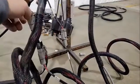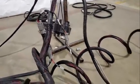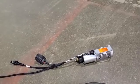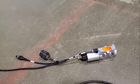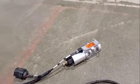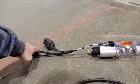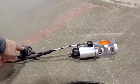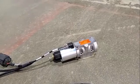That power comes from the auxiliary power plug on that main trunk harness. If we follow the wire that's connected to those two connections, it'll go out and up to the lift-lower solenoid on the main block. The monitor is going to tell whether it wants to be allowed to go one way or the other to control the lift and lower. There's a relay that is triggered by the whisker switch, and this is the connection going to the solenoid on the main block that's going to do the lift and lower. Note there is one plug here that is not used in the lift-lower scenario.